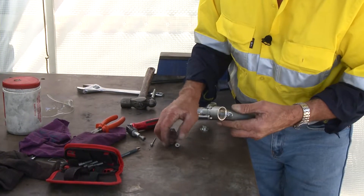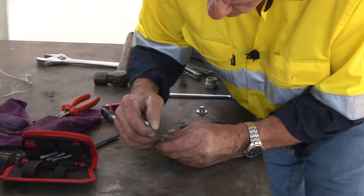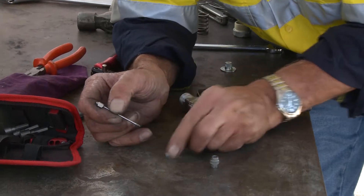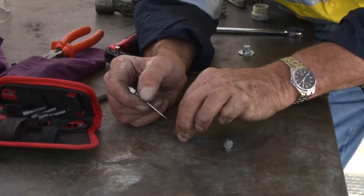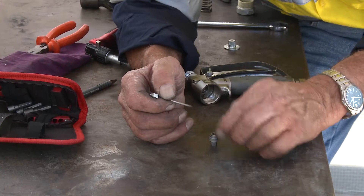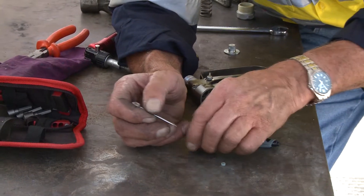Let's have a look at what's in there — nothing? Oh, look at that! So what that is is a double lip seal. When you pull that out, that double lip seal has actually got a tiny little spring in it, so that little spring is what we call a compression seal. That seal does go in one way — remember what I said about Chevron seals and compression seals: the two lips always face the pressure.